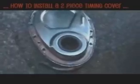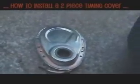This is thicker and it's nice and flat, and plus I can get in here and put this thing in and glue it in a little nicer and see what I'm doing. And of course I've taken these corners here and cut them, rounded them off with a file and smoothed them out there to make it a little easier for it to stick in there. I didn't want to do this, but I figured this is the only way I was ever going to get this thing to seal. I took the old timing cover off. I don't know. It doesn't seem to be doing so good, so it's going to get retired.